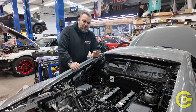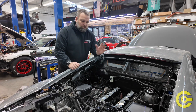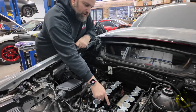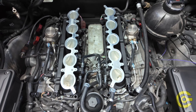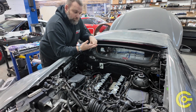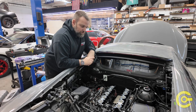We're taking a little break from the time-lapse. That was very long because we were going through and eliminating a lot of things you don't need on a MoTeC car. This is a supplemental video — a lot of you probably aren't going to go with this billet intake manifold since it's not absolutely required, and the same thing goes with the MoTeC. But when you're in there, you can eliminate a lot of stuff. There is a ton of solenoids and vacuum lines that operate your secondary air control, your exhaust valves, and your EVAP purge solenoids. You can get rid of two of those three — you have to keep the EVAP because that system needs to function properly, but you can get rid of the exhaust flaps and the secondary air. BoostLogic sells a block-off kit. If you're getting rid of the factory ECU and going MoTeC, there's quite a bit more work involved in decluttering this area.